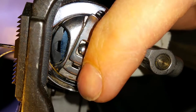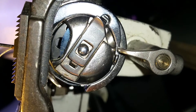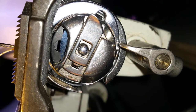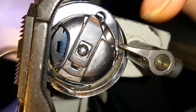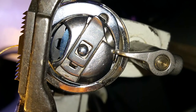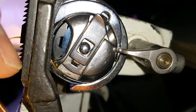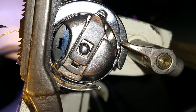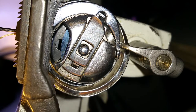See that opens up — this orientation here opens up, see it? Boom, right there. Opens up, swings around, lets the thread come out, pops out and comes around and creates a knot. Needle's all the way up — you can see it up here. Complete rotation, boom, it opens up.